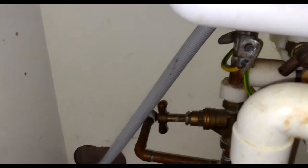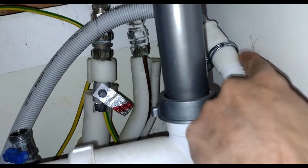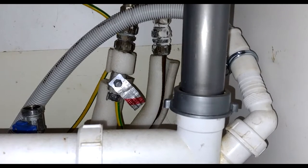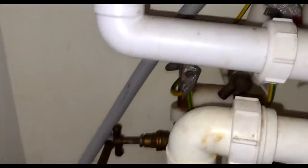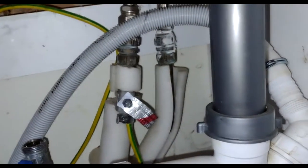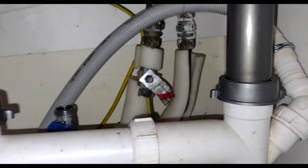I've routed the exhaust from underneath and fitted the connection, and you can see this clip has been fitted over the pipe for a secure connection - it's better than the jubilee clamp that was there with the previous dishwasher. Something to remember while fitting both the inlet and exhaust pipelines: it's best if there are no kinks - the routing should be as smooth as possible, no kinks or circles that could restrict the flow of water. The pipe has been routed and I've tried not to have any kinks.